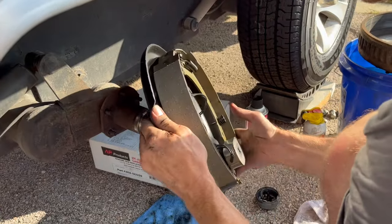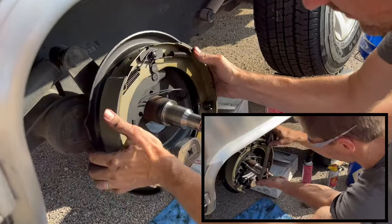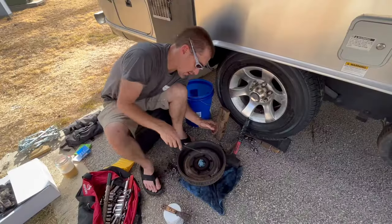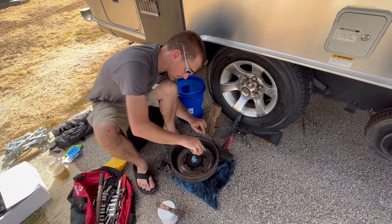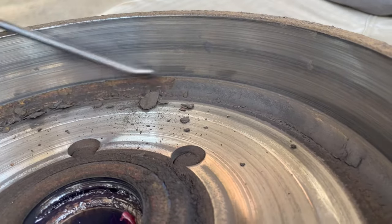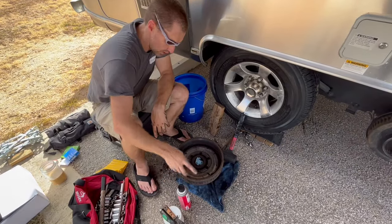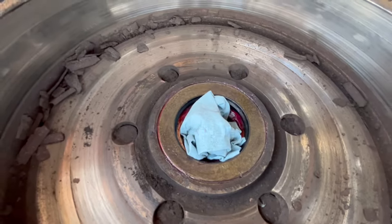The backer is in place and slid onto the studs. Next I've got to clean out the residual brake dust — mostly in the corners of the drum. You can see it comes off in chunks; it's just been packed up in the corners. When using brake cleaner, you don't want to spray it where the bearings are because it will destroy the grease.